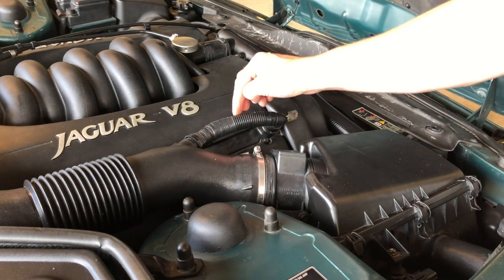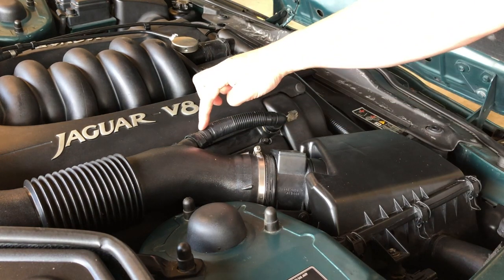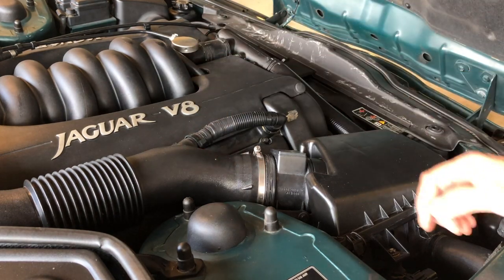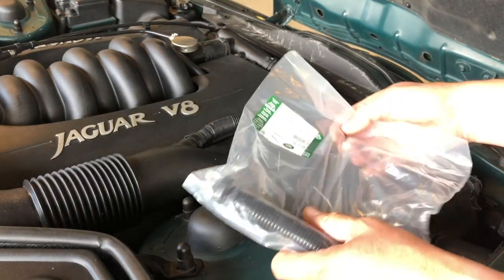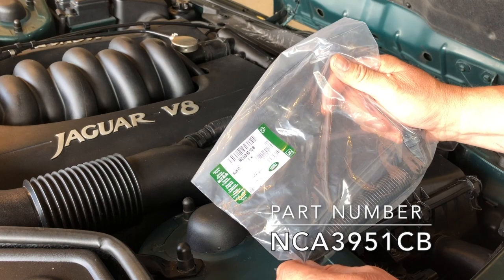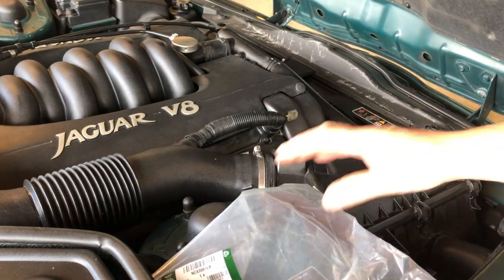These pipes are really brittle. The plastic that they were made of was not really good enough, and the temperature of the engine bay eventually kills them. And you can see this one's already got tape wrapped around it. And it's not self-amalgamating tape, it's insulating tape, which won't keep a seal for very long at all. So that's coming off and being replaced with my nice shiny brand new one. A genuine Jaguar part. I'll put a link in the description below to one of the places you can get these. They're not stupid expensive, probably because they're practically a consumable part.